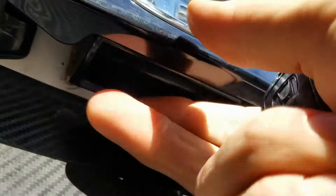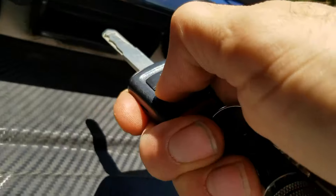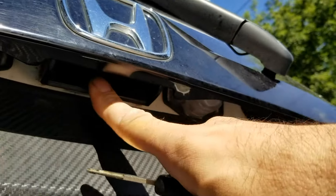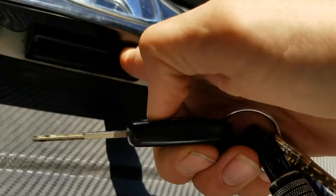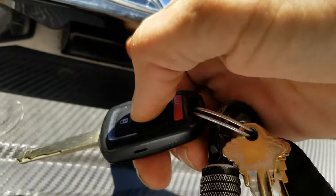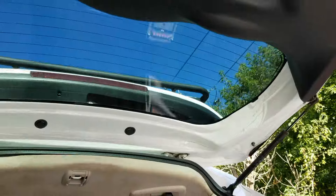Unlock the car — the lever is usually smashed back. Try to unlock it and nothing happens. Push it forward, but also push on the back side of the lever and push inward. Hear that deeper click — there we go.